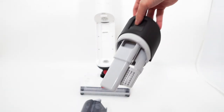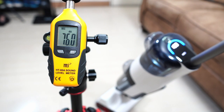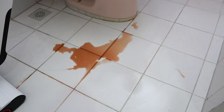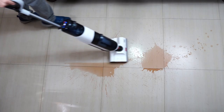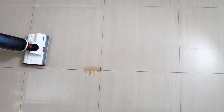Consumers should be careful when removing the water tank since the top cover doesn't lock in place — make sure to hold the handle or the container will drop. It's not a big issue once you get used to it. This product is noisy, registering 76 dB in eco mode and 80 dB at the max setting. The eco setting is sufficient, as it can pick up liquid even in tile crevices in the bathroom, so the max setting isn't a necessity. The Roborock Dyad only picks up everything on the forward pass — moving the nozzle backward leaves a misty blanket on the surface, potentially leaving watermarks.